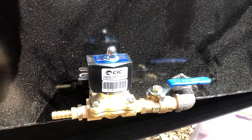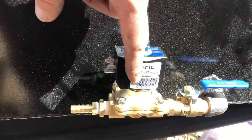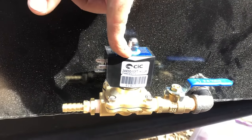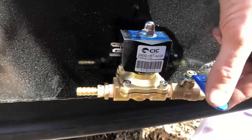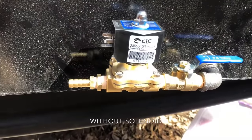This is the setup I use coming out of the tank. It's got a master shutoff valve — this is an electric solenoid so you can control it inside the truck whether you're filling or not. You can also just do this manually — just leave it open and it'll gravity feed into the tank as you're going until the auxiliary tank is empty.